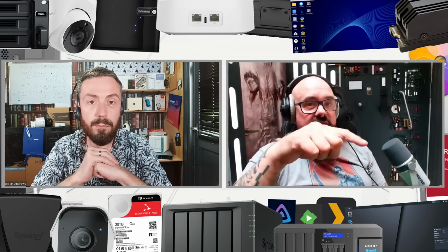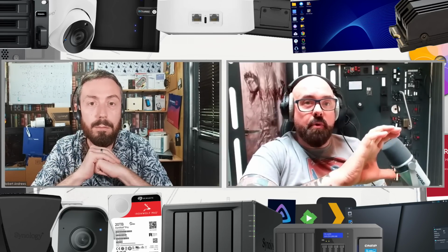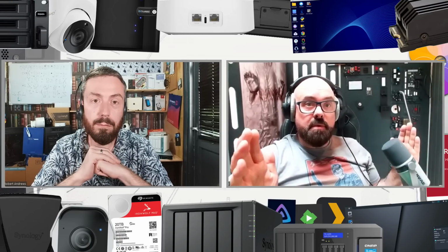Yes, they are going to be built around efficiency, but there's one thing with the regular UnRAID array that I would say turnkey NASs can't do. If you're not wanting a workload that has mega speed, so you're not going to have any ZFS pools or other pools, when you're using an UnRAID array, say the data you're accessing is on disk 1 and you've got 10 disks in the server, only disk 1 will spin up. We don't need to spin up all of the disks, but on a normal NAS, all of the disks will spin up at once when you need to access any data. So just the way UnRAID's array works, it's more power efficient out of the box without you having to do anything.